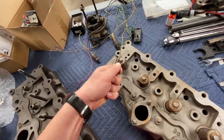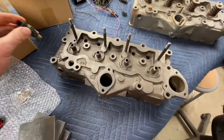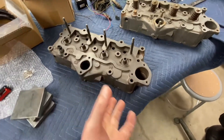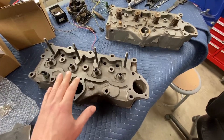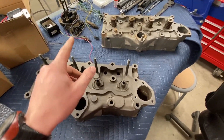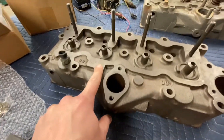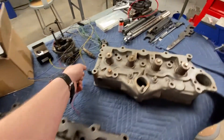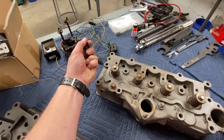I think with that said, I'll be able to use a pretty much unmodified cylinder head, because of the coolant sensor port in the block. My throttle body will bolt on, and my mass airflow sensor will float out somewhere in space as part of the intake duct. So I won't need to modify the intake at all to fit the intake air sensor. I thought at one point I was going to have to drill out one of these bosses to tap it in, but with the Ford 6-wire mass airflow sensor I should be able to get away without doing that.